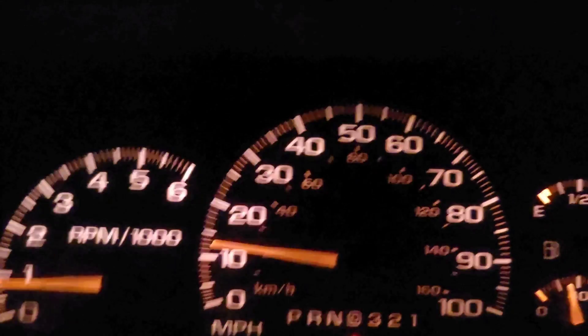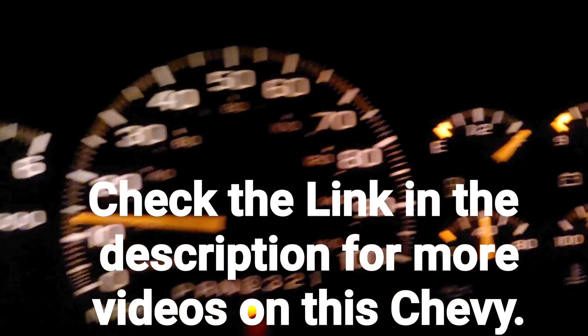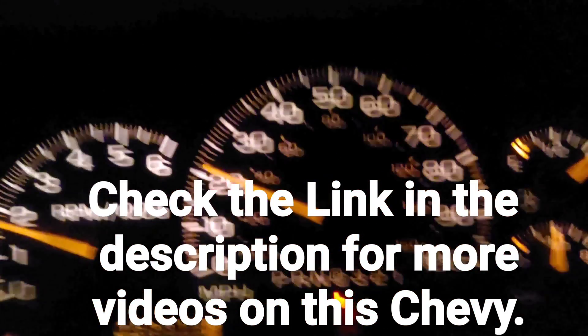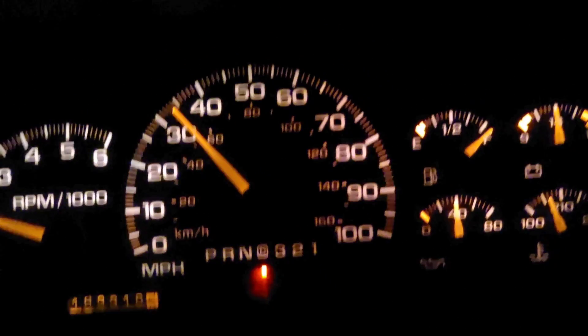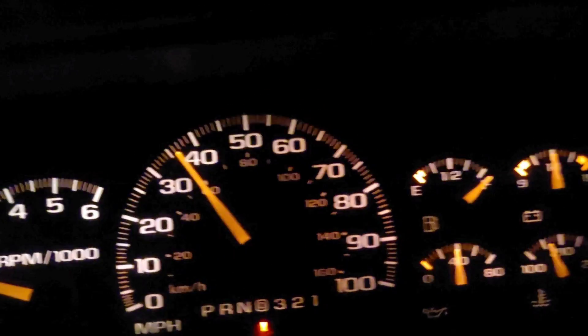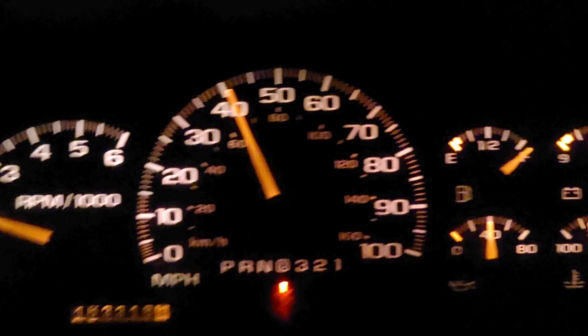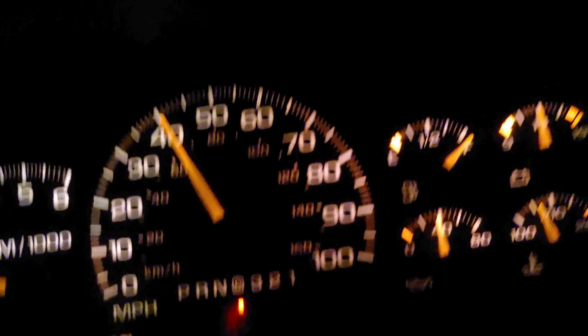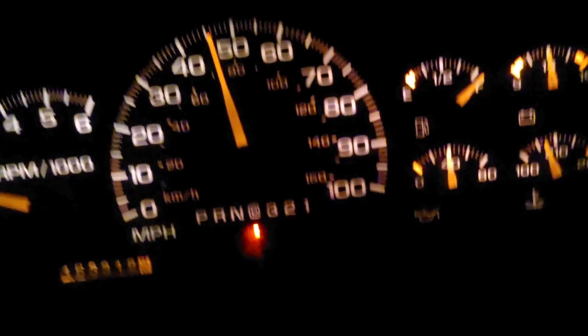I hope this helped you. I'd definitely try the VSS first — it was the cheaper fix at about $100. I'm going to drive it and hope for the best. It was a lot simpler than taking all that off the dash and changing the ignition starter switch. At least I know it's got a fresh ignition starter switch and now a fresh VSS — vehicle speed sensor. I'm just thankful it isn't my transmission more than anything. Praise God that was all it was.